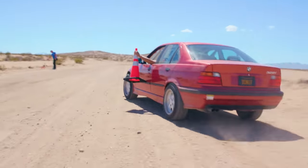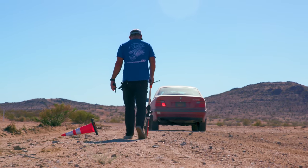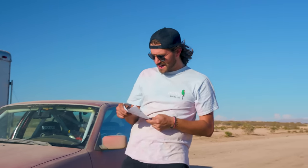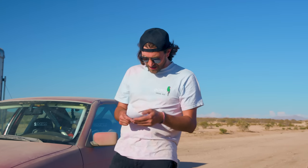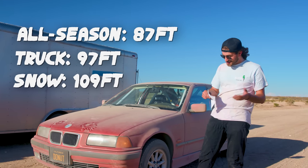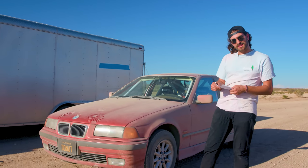The first set is already on the car — let's do a 40-to-zero braking test. The results are in: 40 mph to zero, first time out we hit 105 feet. The Yokohamas were the best at 87 feet. The Coopers came in second place at 97 feet. And the Continentals were a distant third place. I'm a little surprised — I guess those Yokos are better than expected. Now let's see how this thing does in terms of acceleration — zero-to-60-foot times.